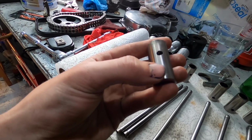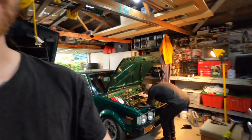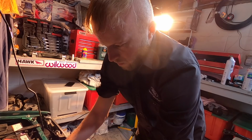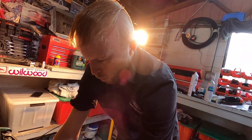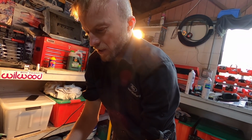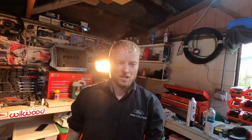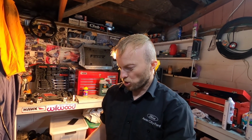The good thing about us having taken it apart is there was this oil residue built up on the bottom here, and that was what was making these lifters super hard to get out. I went over it before with some Scotch-Brite and some CRC and got rid of it and cleaned those up. When the bolt stripped out, I left the motor at a point where we can literally just put it all together, and it should be at the point where it needs to be. So I'm not going to have to muck around finding TDC, finding the firing stroke, etc. This should all just go back in.